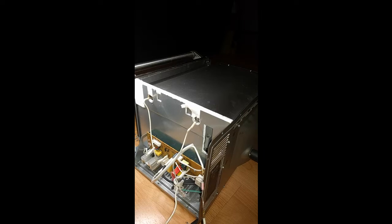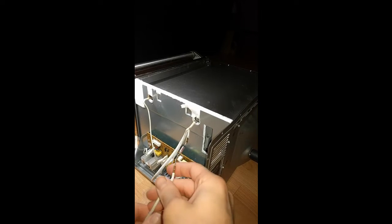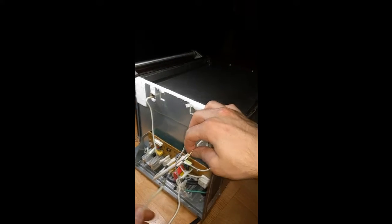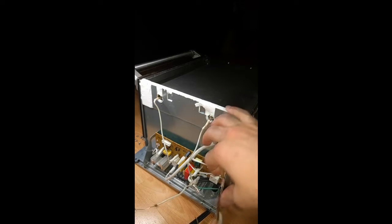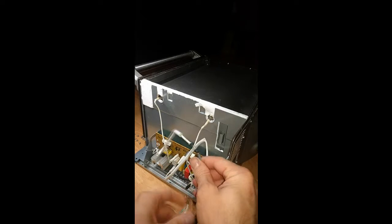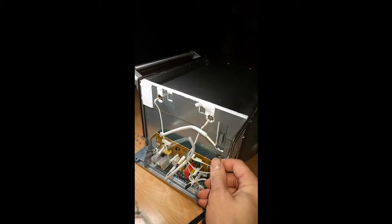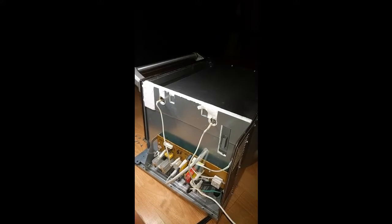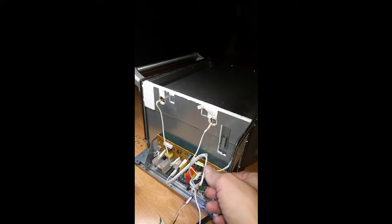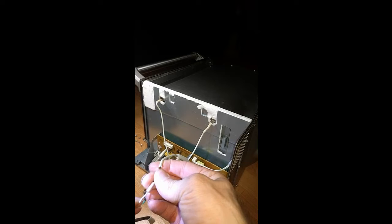All right, so I'm back here with my Breville repair, and I have figured out what happened. This thermal fuse has blown, and fortunately I have another one that, sorry, this is the old one that blew. I have another one from a broken one of these that I had found on Craigslist a while back and used parts from. And so I'm just swapping these 2 fuses, but I'm going to go ahead and look at the part number here for anybody that, of course, isn't going to have spare parts on hand like that.